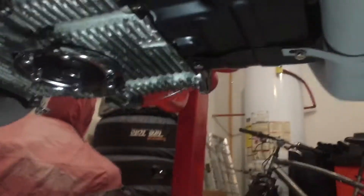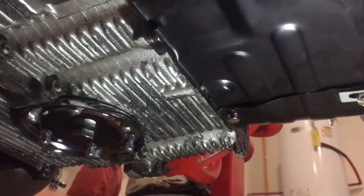The order of this doesn't really matter. Up under here you've got one and two pieces that go underneath the engine, and on the other side there's just one piece. These mount to the heater boxes as shown. They're hard to get the screws lined up, but you've got one, two, three, four — and you're supposed to have five right there.